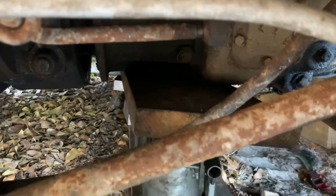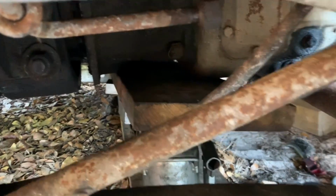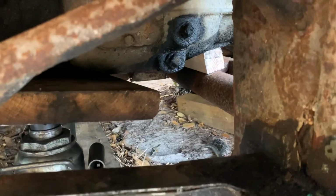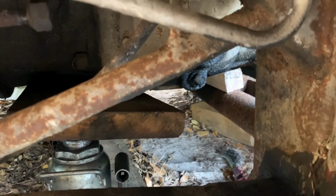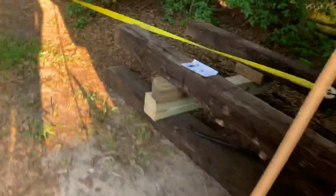As you can see, I have the bottom of the transmission supported, a large board across it with two bottle jacks on each side so I can raise it up, you know, tip it left or right. And then the back of it, I've got some wood shims blocked up under it, and there's a steel member that runs right underneath of it so it can't fall backwards or forwards. And if, when the weight of the engine comes in or off of the cradle, we have to move it up or down, we can do that. So we'll see if this will work. I figure this would be the easiest way to just get the engine out, so at least 3 feet here on the cradle, and then get the clutch out.